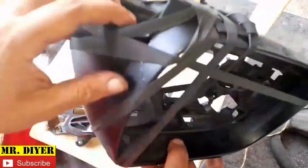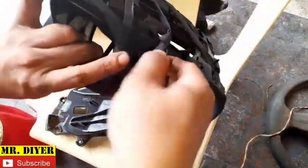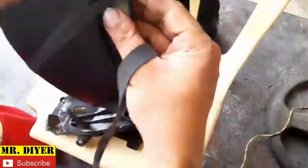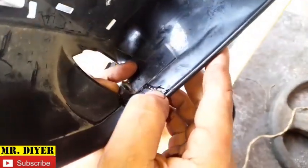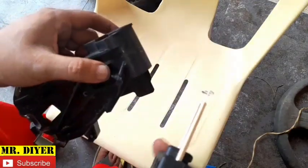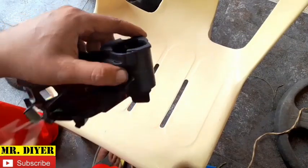Also here, see that? Let's remove the rubber. Okay, see that crack? All the way on the other side. Now I'm not just going to stop with glue, okay? I'm going to use this hot stapler and weld this in place, okay? Now excuse me if you're going to hear a humming sound, okay? That's because of the fan, because I need to cool this down.